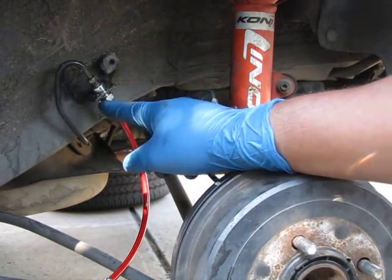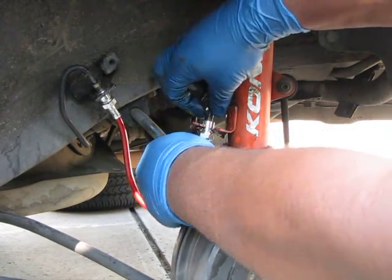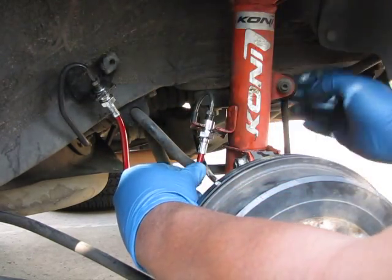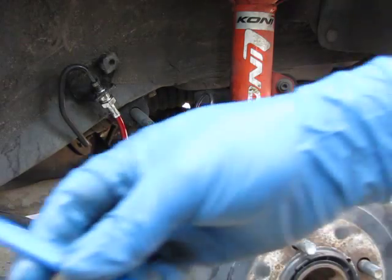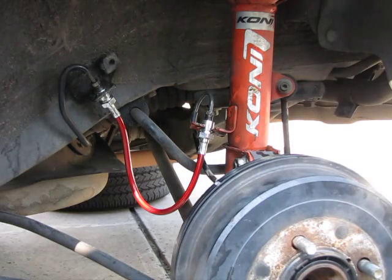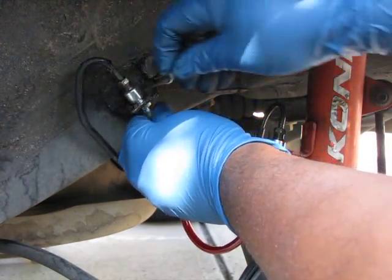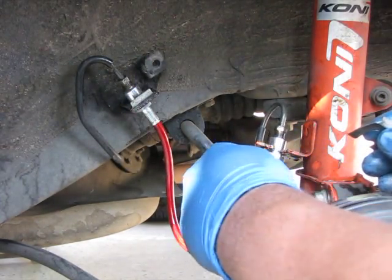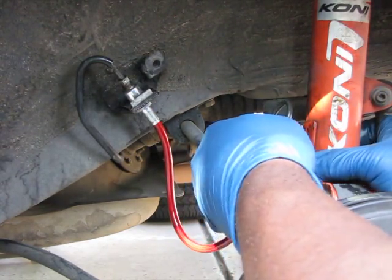In this case I'm going to need to use the wrench, because this is an aftermarket unit and it's not going to fit in there. Once you get that started, you can tighten it with your wrench. And then that's it. You do want to put your little clips back on, because they have a little slot in there that holds this so it doesn't move around. Put your clips on like that to hold your line in place. Do the same here — push it up in the bracket and put the clip on to hold the line.